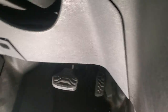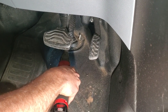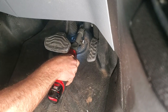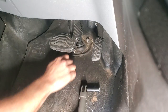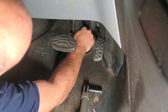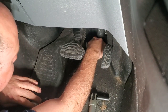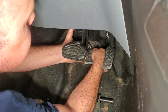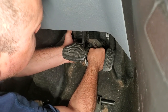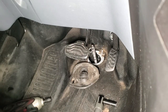You can just slip that up there. There's two bolts on the boot — we thought three, but that was the E350's steering column that has three. Now our rack is free and everything can drop out the bottom. We're going to put her up in the air now.